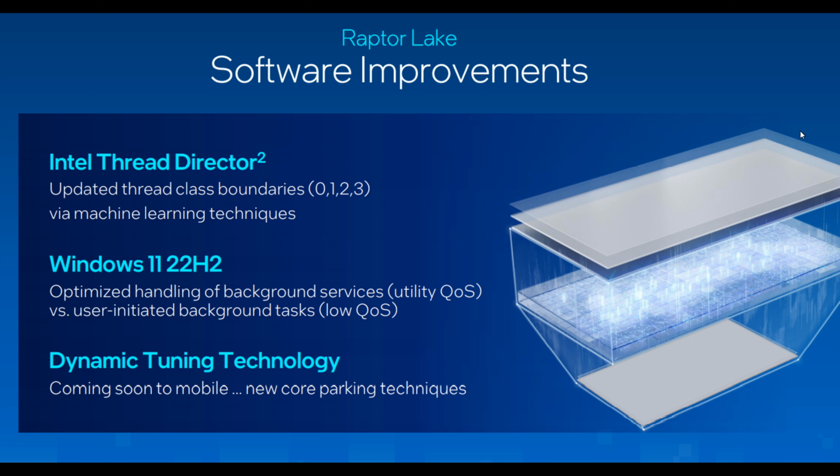They call this occluded windows. So if you just toss something to the background, like some rendering or something, it could have just gone to the E cores, but now it can actually prioritize the task, and even if you send it somewhere, it should be working on that as it should. Now the OEMs have the ability to tune both the QoSs, and they can configure occluded windows tasks on P and E cores. So the OEM and whoever develops this stuff can pick and choose which kind of cores they want to use. I just thought that was important to go over.